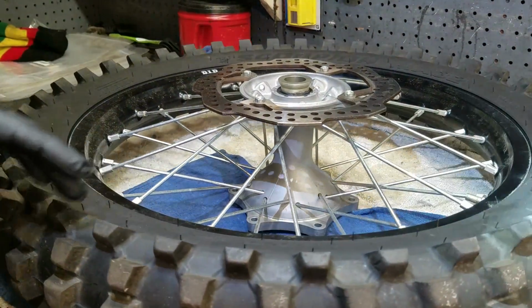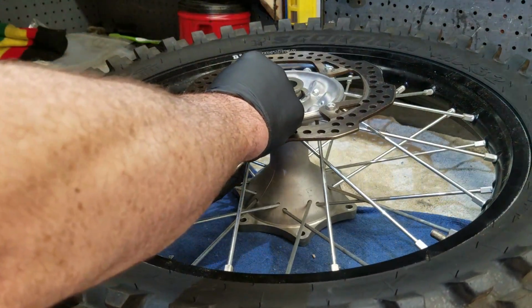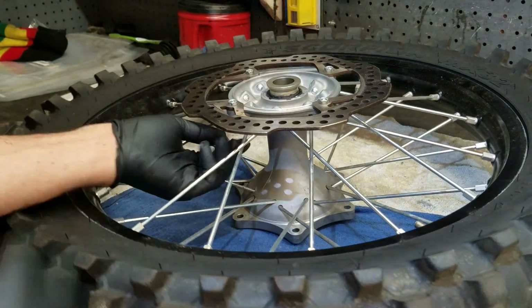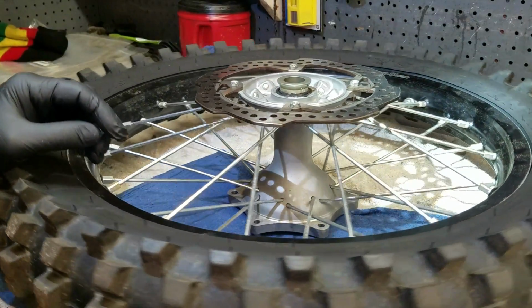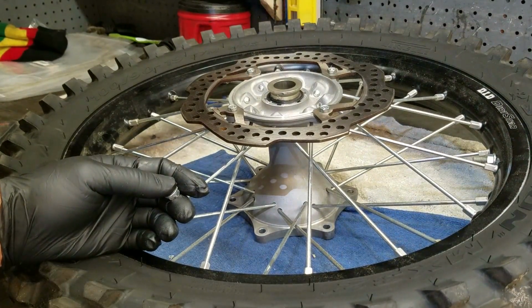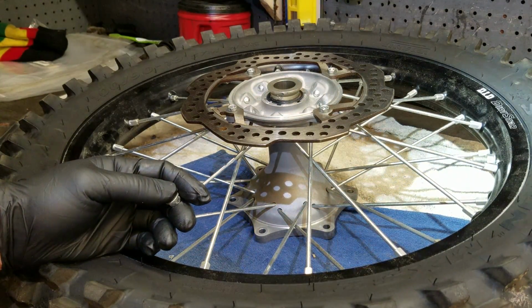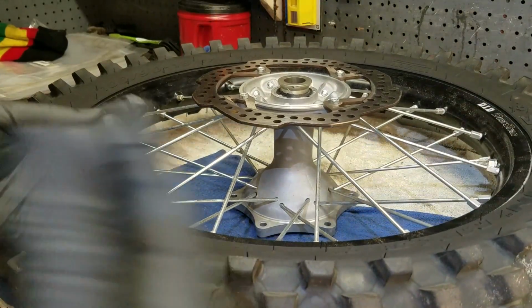Same thing, first ride, make it a short ride, 8 to 10 minutes long. Come back in, check your fluid levels as it's cooling back down, give it at least 15 minutes to cool down. Make another short ride, 8 to 10 minutes long. Now, on these first few rides, you do not want to go full throttle, obviously, and you don't want to go very high speed. You want to vary your speeds.